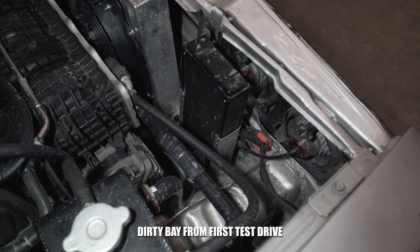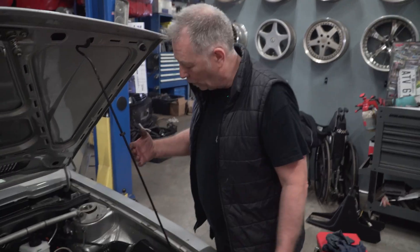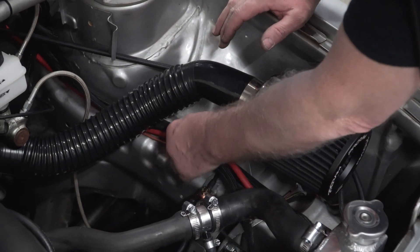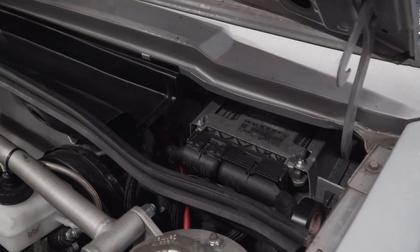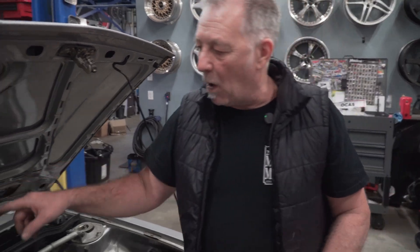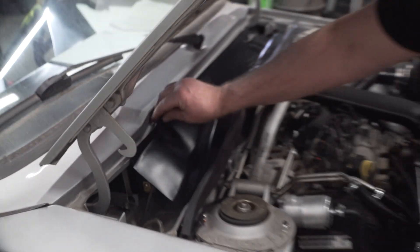For the wiki, I'm going to state all the different items that you need to source from a donor and the items that will come with the kit. We developed the loom with somebody local — it's high quality. I haven't tucked everything in yet, but everything's lined properly. We've installed the ECU right in the rain tray, and there's a small Braille battery also tucked away in the rain tray underneath — made a little bracket for it, makes it nice and clean.